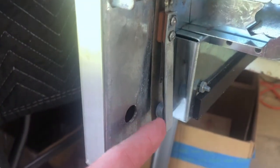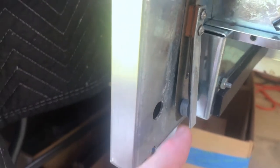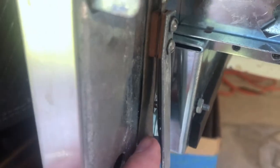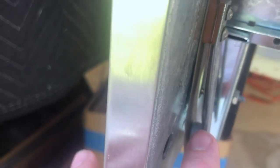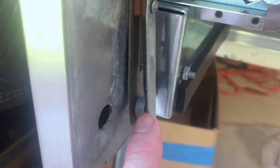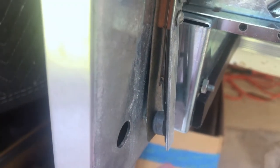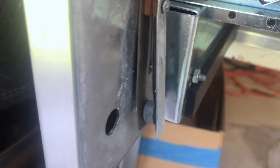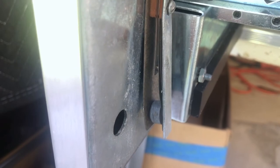Inside the door here is the first one. The way to think about it is: a tilt switch is normally open, and a slam switch or anti-cheat switch is normally closed — you can use those latter two terms interchangeably. So we're going to call it a slam switch. It's inside the door, normally closed, and it is the first of six switches on these mid-70s Gottlieb games. There's a little weight, and if someone was to kick the door really hard, it would move that pendulum, open this switch, cut power to the game, and end the game. That's the first of six.